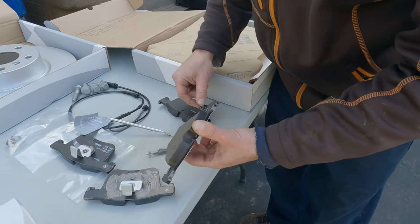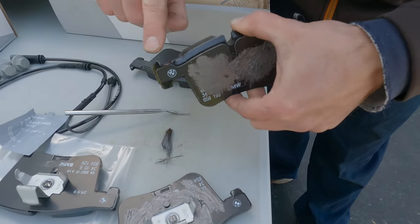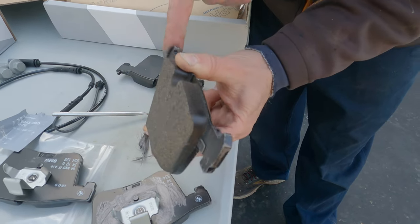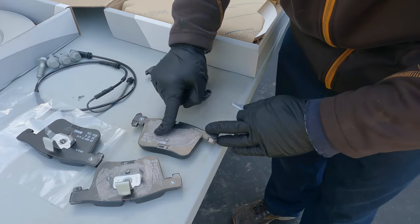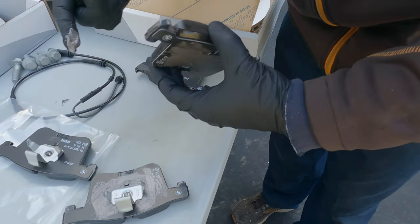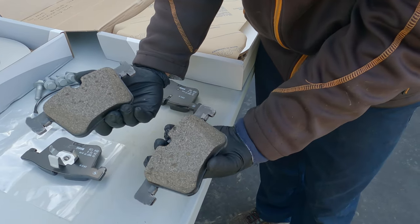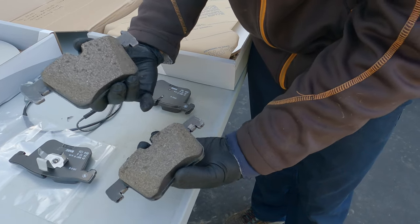The brush just failed — so I'll just use my finger. I cleaned it off because I saw all the brush material on it. Same thing: just use your finger if you don't have a brush, or get an acid brush at a parts store. Just don't get any oil, grease, or brake pad paste on the contact surface of the brake pad itself.